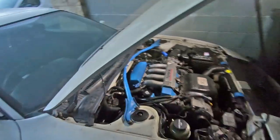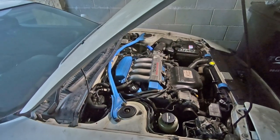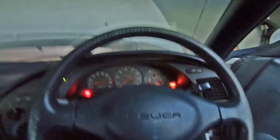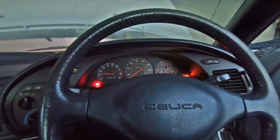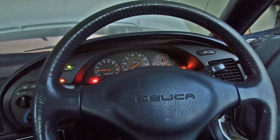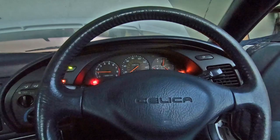It took a while to run because the fuel system was empty. So just leave it a while. Yeah, a bit low on fuel, and it's a bit stale as well. It'll be at least 2 years old, so it would probably benefit from some fresh fuel. I'll just run it for a bit and see what happens when it gets up to temperature.